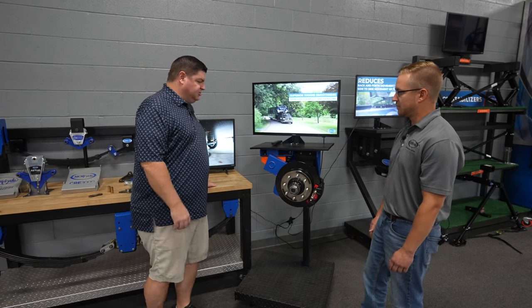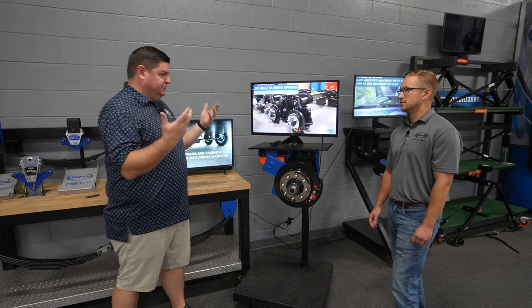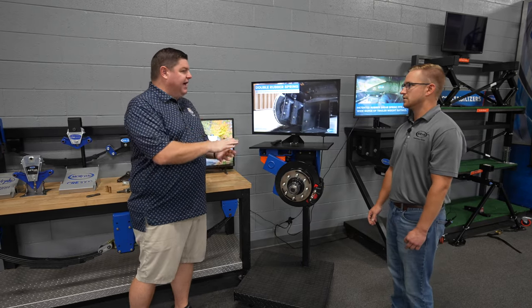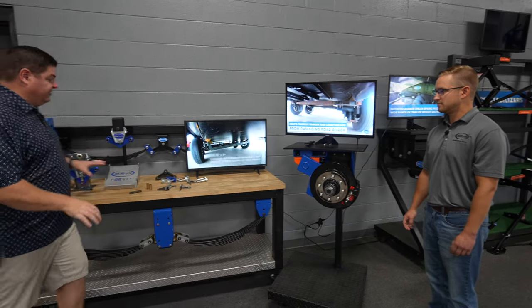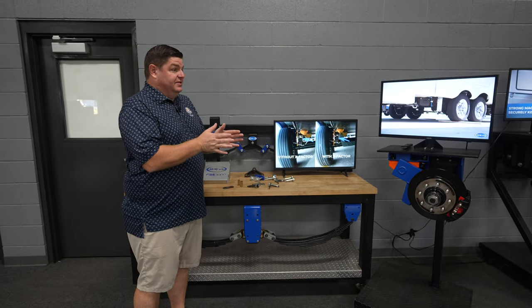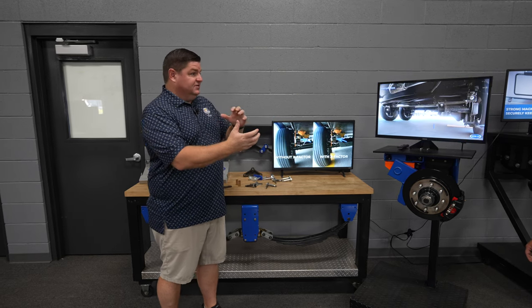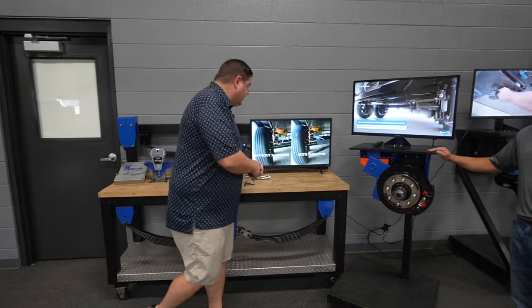So if you hit the side of a pothole, let's say, it's actually conforming to the pothole a little better to reduce the wear and tear, the actual impact on the coach. Yep, you're cushioning. On any other system, whether it's stock or CRE 3000, 4000 all trail, it's very vertical. It stays vertical no matter what. And so that's when you get that rubbing of the tire, like if you cut real hard, the tire actually gives a little bit and you see it kind of twisting back, especially that rear tag axle.